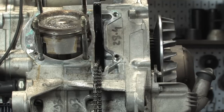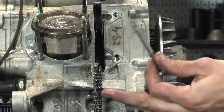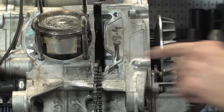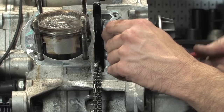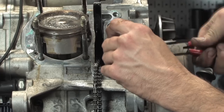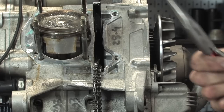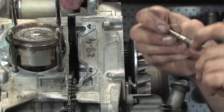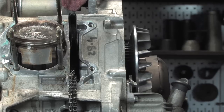They're not all that expensive to replace, but a way to remove them is you find some sort of round object, whether it's a slightly larger screw, something that fits snugly into the actual dowel. And now if you squeeze it, it's not gonna distort it. You can grab it with whatever and kind of work it, and it doesn't distort the dowel if you're squeezing it while it's on a rod. You can see how nice it fits onto this rod that's part of a Torx driver. But you can find something like that. Nice little tip. Nice little trick of the trade.